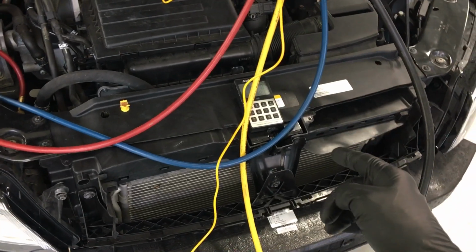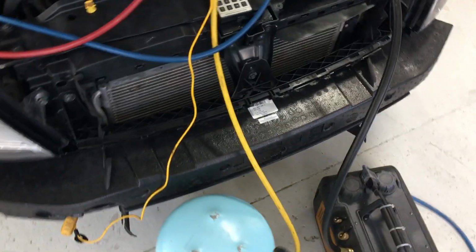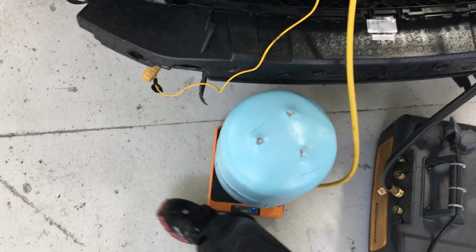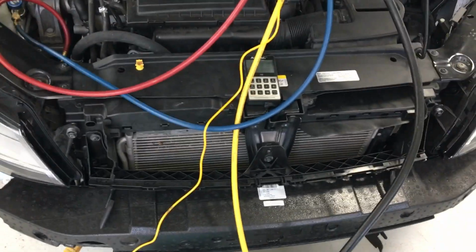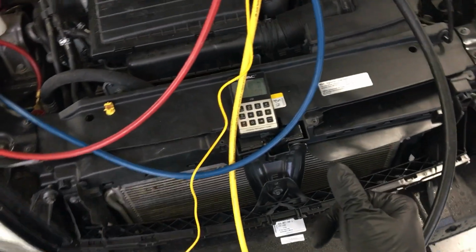In my earlier days, I didn't pay attention so much to people around me, but it's happened to me. And you know, other technicians don't know how important it is that the scale not get bumped. And it happens, somebody doesn't say anything, and you were already partially through your charge, or you're performing some procedure, and it really can mess your diagnosis up.